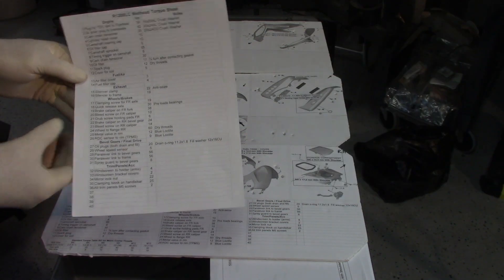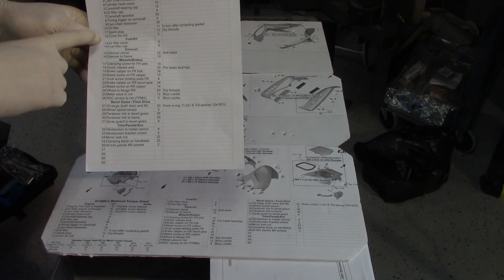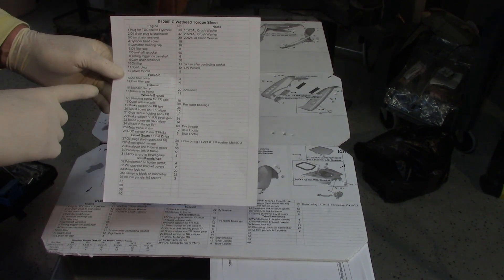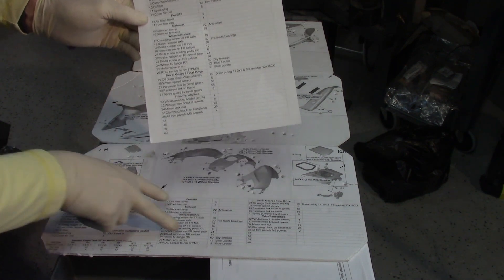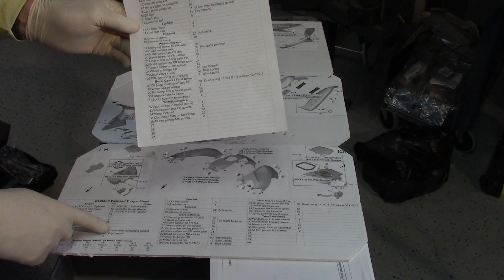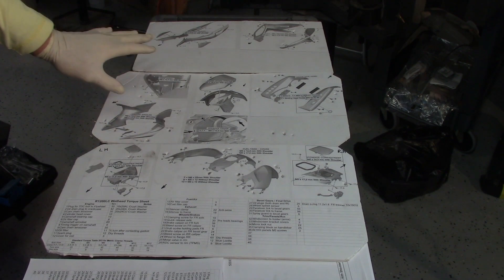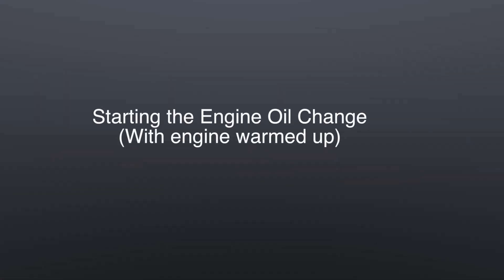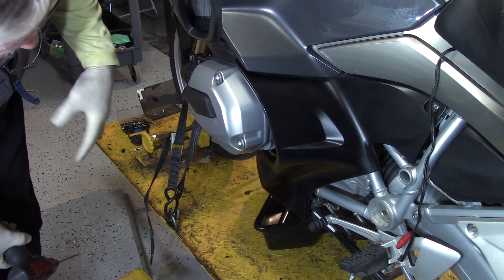There's also a small worksheet I made specific to the liquid-cooled wet heads — the torque values used for almost all service parts of the 12,000-mile service — cut into small sections and glued onto the work aid. This handy sheet will be used all day to put all the screws in place, take them off, and put the panels back on when we're done. Next we're going to drain the oil, starting to remove panels from the bottom to the top.